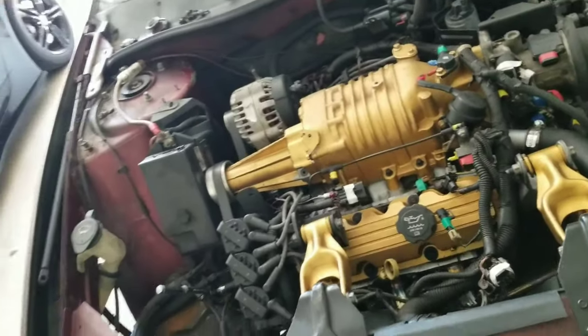Just one more thing I forgot on this part — you've got to take these transmission bolts out. There are five bolts total: one, two, three, four, and five. That last one is going to have a big negative ground on it. And that one right there — that's another bitch bolt. So that was the last thing I needed to add to this video.